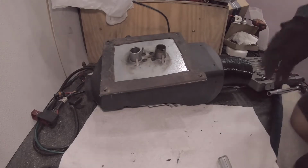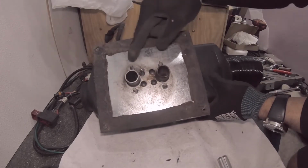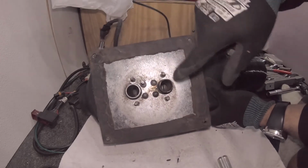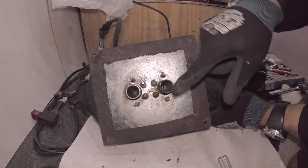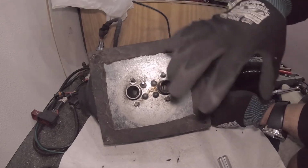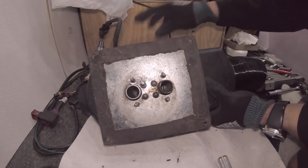All right, attach your bottom mounting plate, and then there are four nuts that secure to the diesel heater. 1, 2, 3, 4. The side that has the dark exhaust, the dark side, that's your exhaust side, and this is your intake side. And this little nipple is for the fuel feed. So just go ahead and reattach all of that, and it should be good.